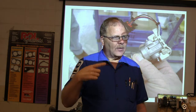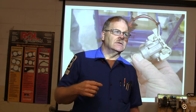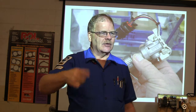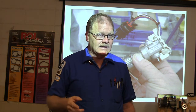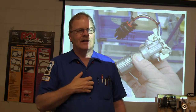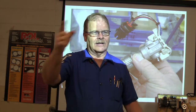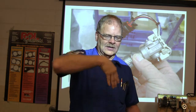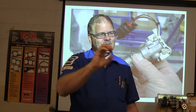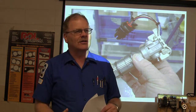But the problem he had was his tires were too old. If they're over 6 years old, it doesn't matter what the tread looks like. They can throw the tread off. And that's what his did. And it cost him a vehicle. See, it didn't hurt him, but he flipped it over 5 times. And you could see the tread that had come off of it looked like a big ribbon out there. And it had nice, deep tread, and the rest of the tires still look really good.